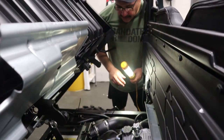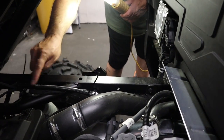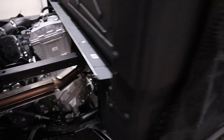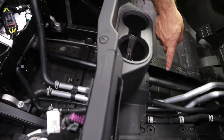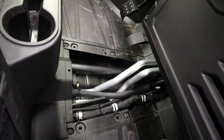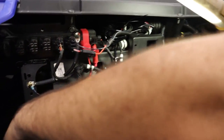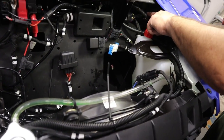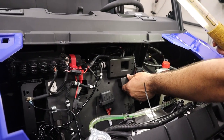We've got this all wired up. We ran the wire along the main wiring harness, zip tied it, ran it through there, came out through here on the main wiring harness, all the way down through the tunnel and out the front. We ran this wire all the way across, plugged in the light here, ran it back, hooked up to the turn signal switch on the steering column, ran it over and plugged it in, and mounted it right there. That's it!